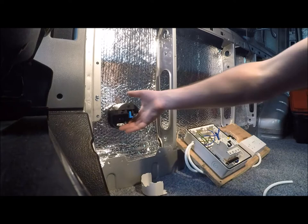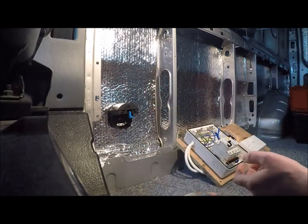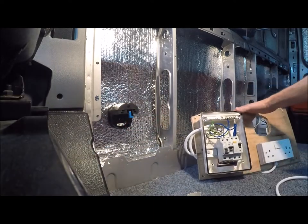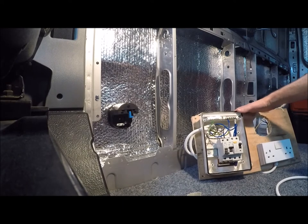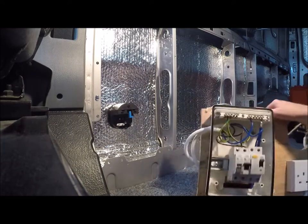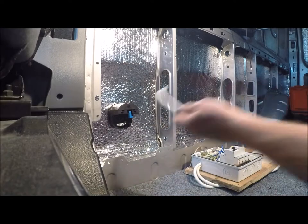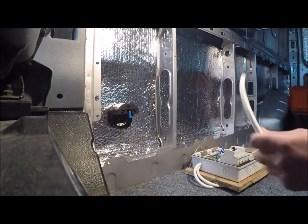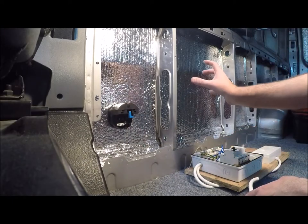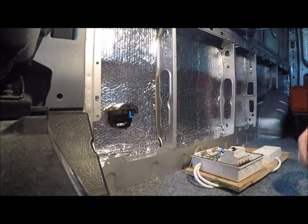We have the external socket poking through the van. I've taken the case off, and now it's a case of wiring this up to our fuse box. I'll put a link in the description below for the fuse box I used. At the moment it's connected to a piece of wood because I've been using it over the summer and just had it hanging. I need to cut a length of three-core wire long enough, since the fuse box is going to be mounted on the inside of the cupboard. I'm going to cut about a meter and then wire it up.